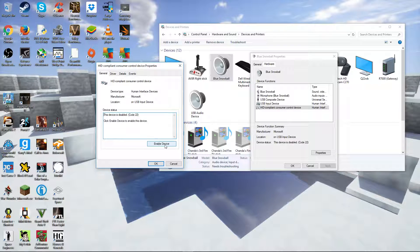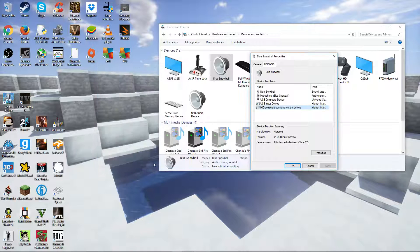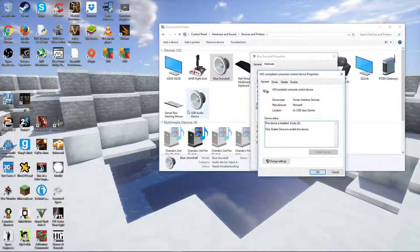You click on it, go to Change Settings — it will pop up the window again. Make sure it's the HID-compliant consumer control device; it's important that that's what it is. You won't have a disable button right here yet — you're probably scared, but don't worry, it's here. If I were to click Enable, then this would become a Disable button. So just by the act of turning the thing back on, it cut out — it committed suicide. It went away. That's pretty conclusive — that's the problem.